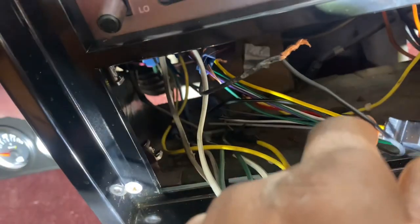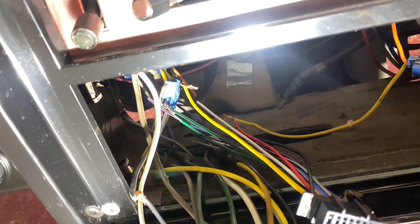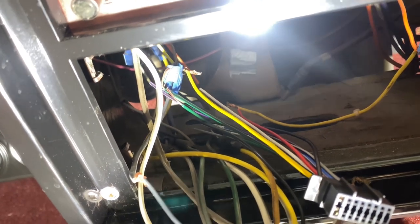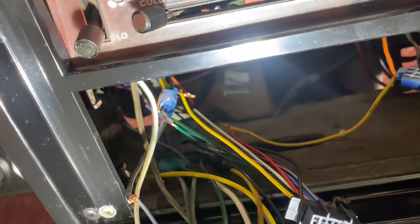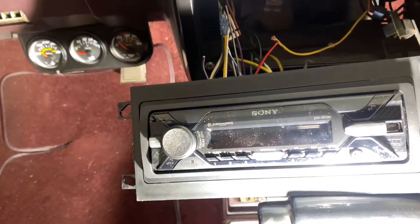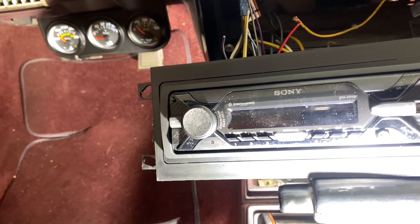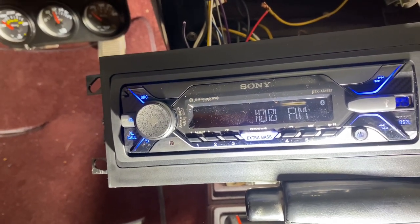I found my ground too — most cars use black for ground. I know the expert mechanics online will say tape it off, but the wires aren't touching so I'm fine for now. Once I show y'all it works I'll take it apart, tape it all up, and get it going. I'll probably hook up one speaker for now. Let me set the camera down, hook this radio together, and see if the screen actually powers up. I plugged in the radio and we're going to turn the key to accessory and see if it powers up.